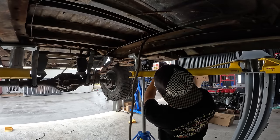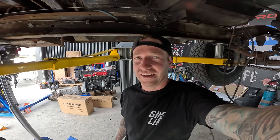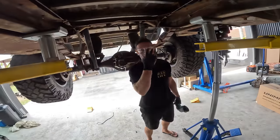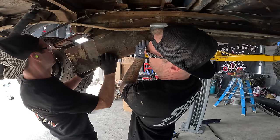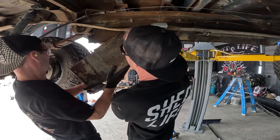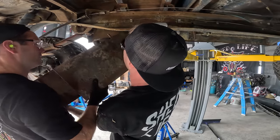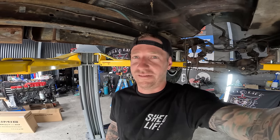Really old fuel tanks. They are empty, but we're still a little cautious. I like my eyebrows where they are, you know. So we put water in them and cut the bolts off that are on the bottom. There's a bolt that goes all the way through and we're very carefully removing these without causing any sparks to cause a flame to blow us up. Of course, safety first.